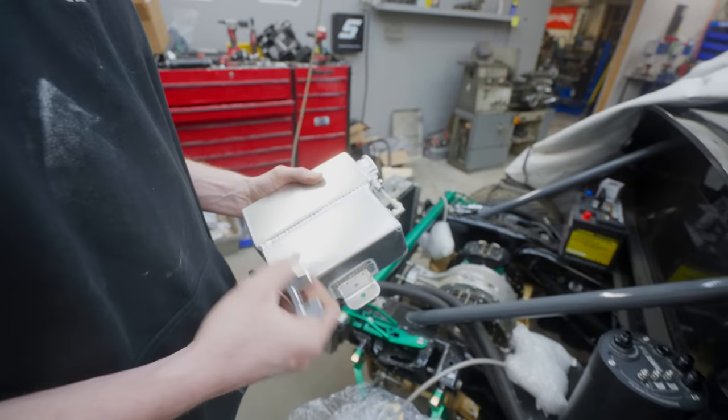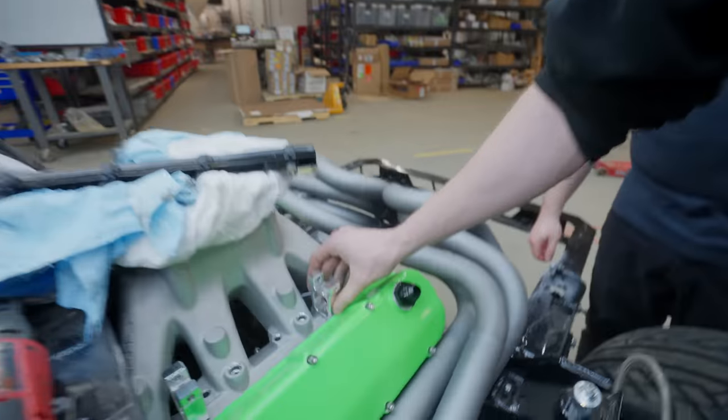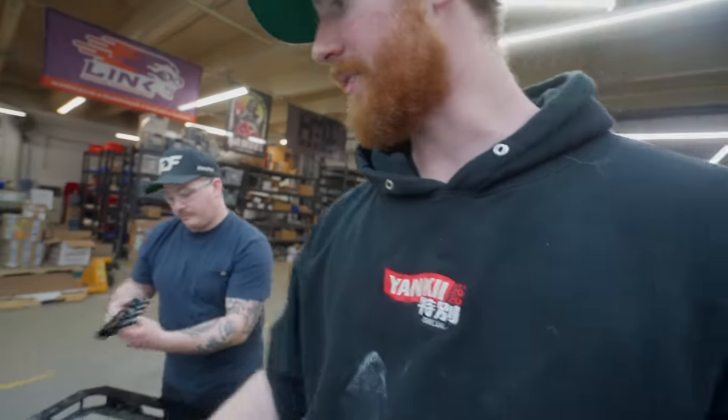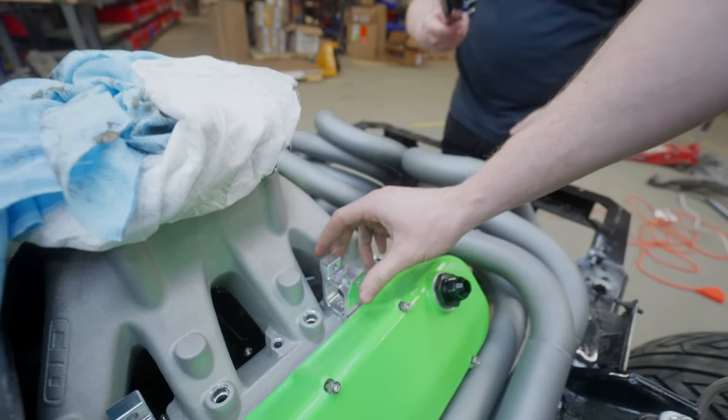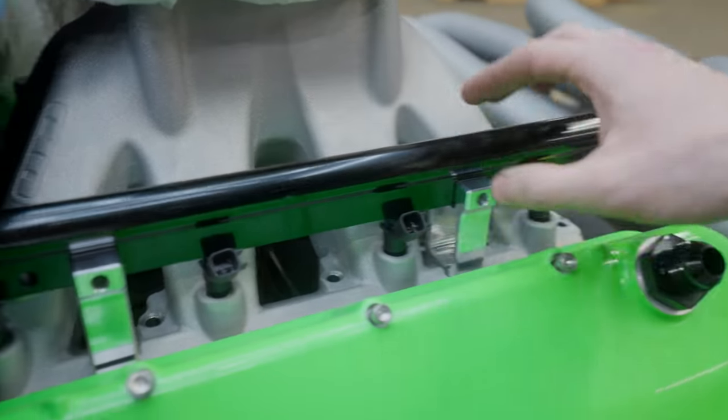Expansion tank — overflow — got to mount this on there. There are new fuel rail supports. The most common thing that causes fires is the fuel rails lifting and the O-rings not sealing, then fuel spraying everywhere. Dilly made this beautiful double-shear super solid mount that's going to hold these fuel rails down and in their spot — no chance of the brackets bending. Be careful with those O-rings, Dilly. They should be fastening up, actually. We just have to transfer drill some holes through them.